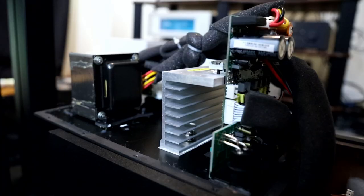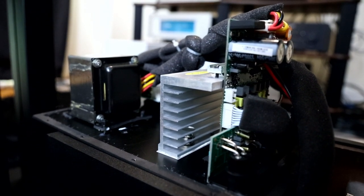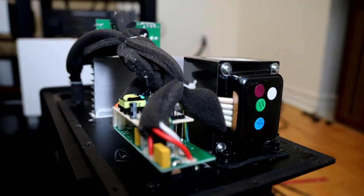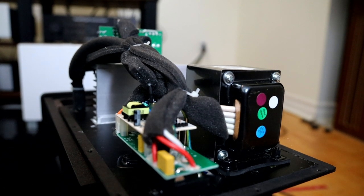Although I feel like these have serious bass — and we'll talk about that later — if you want to add a subwoofer for extra bass extension, you can do that. This is an active loudspeaker with amplifiers built in, so you may need a source, a DAC, and a pre-amplifier, but you don't need an amplifier. And unlike typical monitors that use Class D amplification, the Focal here uses 80 watts of Class AB amplification for the woofer and 25 watts of Class AB amplification for the tweeter.